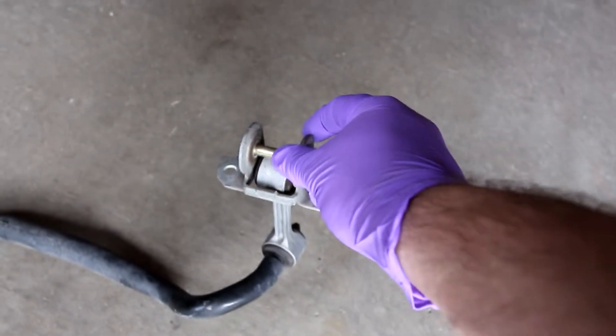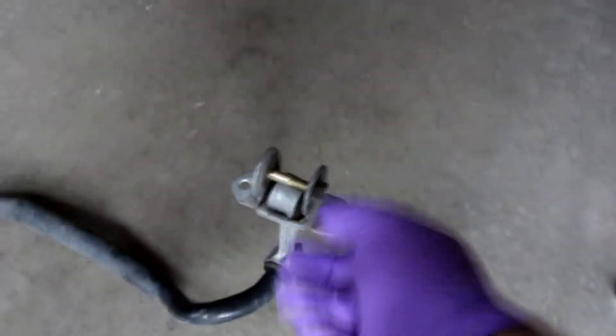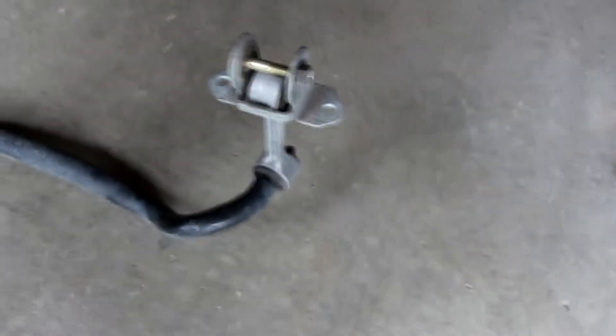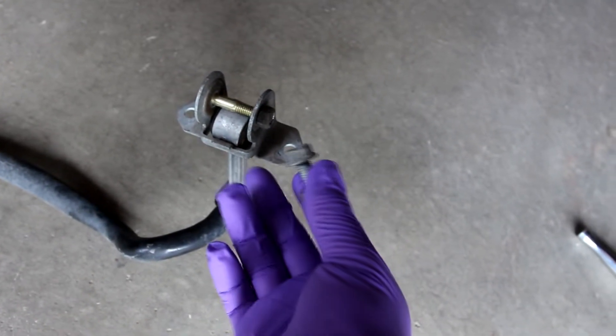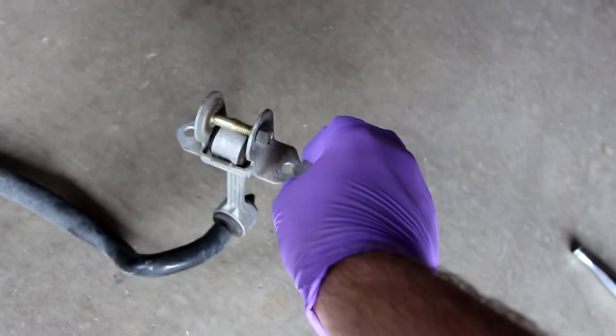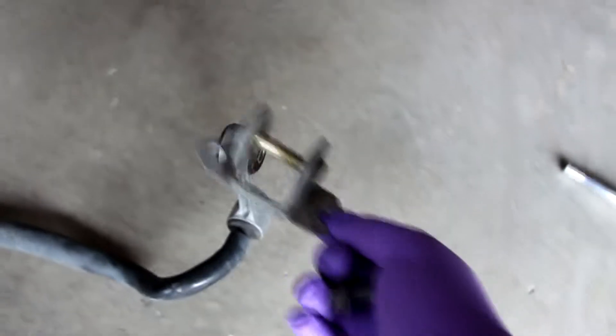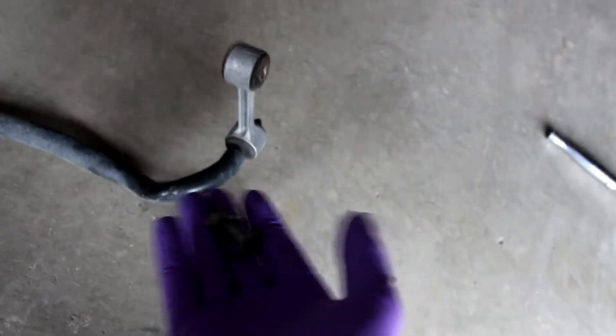Here we've got the rear sway bar out, and I did have a little bit of trouble — this is the driver's side one. There are two things I wanted to mention that I didn't before. This is the piece that goes on here; there's a bolt that goes through it to a nut — they're both 13mm on both sides, so you can pull it off with just two 13mm sockets, and then this will slide out, which allows it to get out of the wheel well a little bit easier. Another thing I didn't mention: these guys have bolts on the bottom — 13mm bolts — and a 17mm bolt on top, so you want to hold the bolt on top with a 17mm and then the 13mm nut on the bottom. They're pretty easy to access from up here.